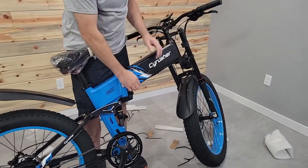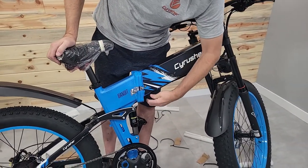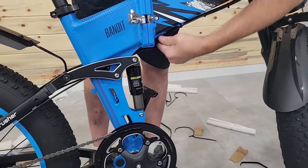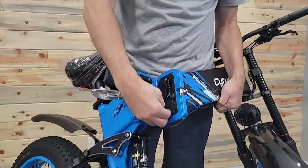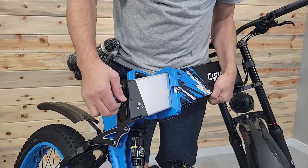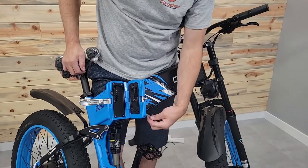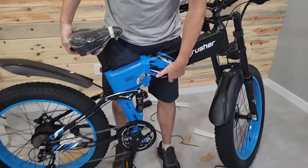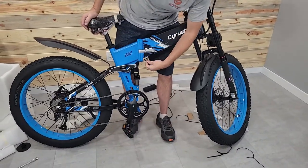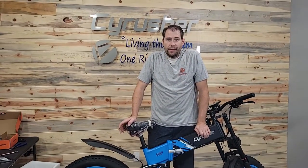This is the 690, the folder bike version. The key locks the battery onto the bike — you can see that pin drop in. With it out you can lift the battery up and remove it, though sometimes these are a little hard to get out. The key has no effect on whether the battery is turned on or off; it strictly locks the battery onto the bike. Lock it on and you are ready to roll. Thanks for watching — if you have any questions feel free to reach out to us and we're happy to help.